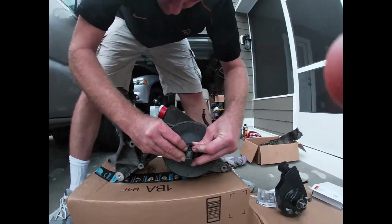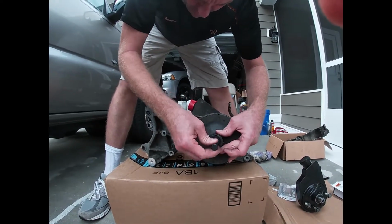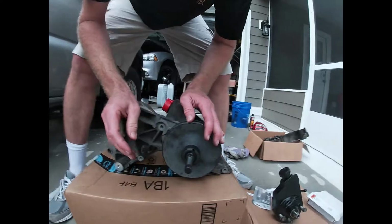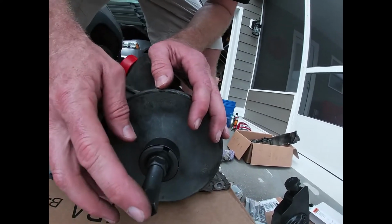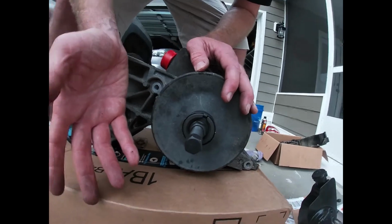actually you tighten this thing here, but you have to keep this collar on here. As you get it finger tight, okay. So now it's nice and snug. Well, I did this while it was on the truck, and that's fine. And I put a 16mm socket on here with a 3/8 long ratchet, and it went to popping, and it was acting like it wanted to come off.